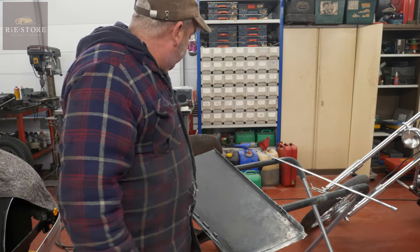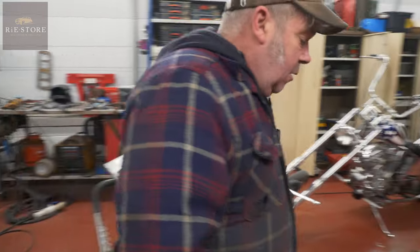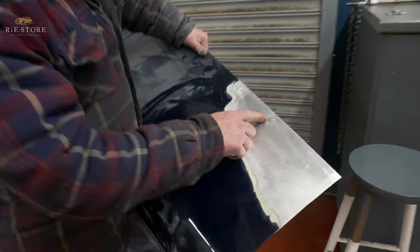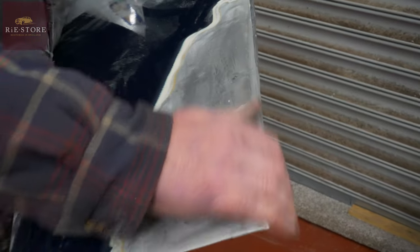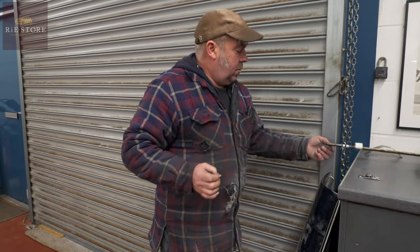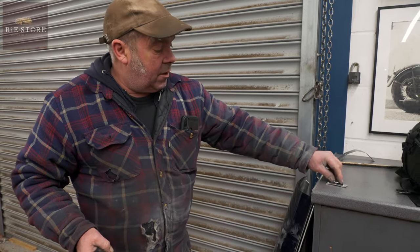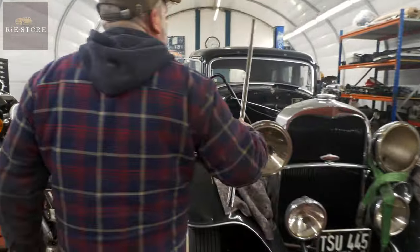The rear ends and back edges I could get just by repairing and body filing them up. This one I've done — you can just see some of the marks where I welded it in. That's nice strong two-mil-thick alloy, it's not going to bend. That end's all repaired as well. We've got to repair the center bar but somebody had welded it with all the bonnet hinges still in there, so I've had to unpop-rivet all of those to make sure it all goes back together properly.